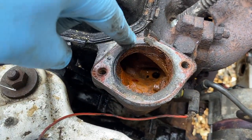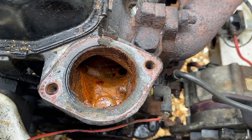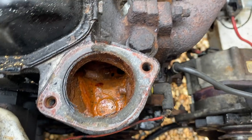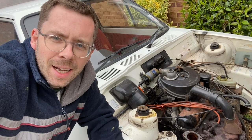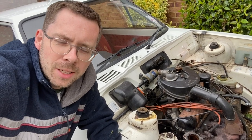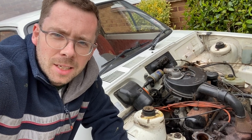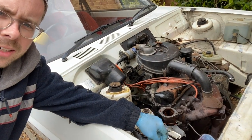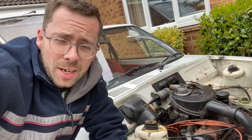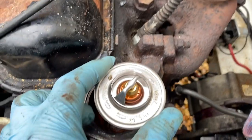I'll get a little blade and gently clean the gasket off, then flush the engine with a lot of water to make sure it's all really nice and clean inside. I've now got the cooling system completely stripped back, cleaned up the thermostat housing, and flushed loads of water down into the thermostat housing, letting it flow around the engine until clean water came out the other end. We're now ready to commence reassembly.